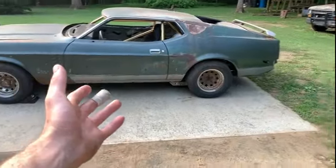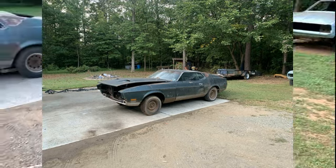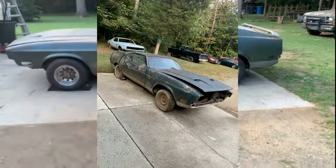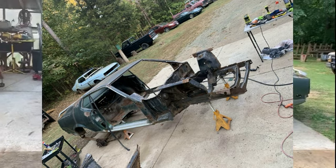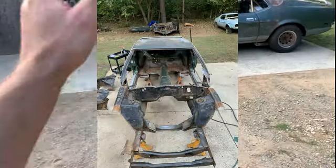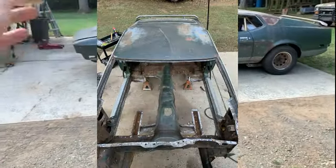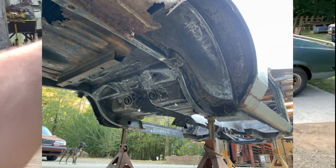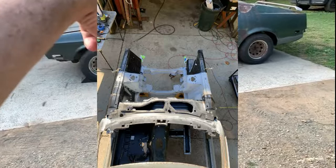When I got the car it had been sitting for about 10 years. My dad had it — it was a rust bucket. The major parts of the car were okay, but the typical rust spots in a Mustang were all rusted out. When I first got it up here it was pretty grimy; took it all apart, cut out all the rust. From front to back we got a new radiator support, new front apron, both new rear aprons, new cowl.